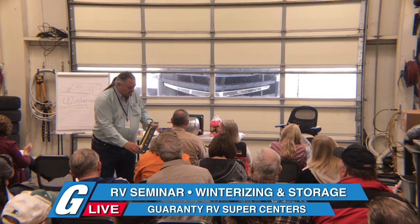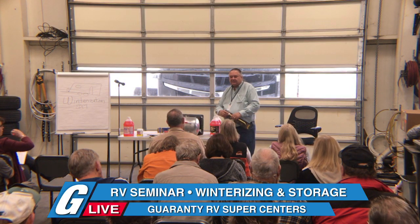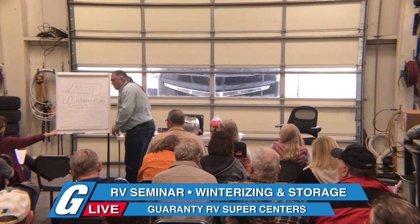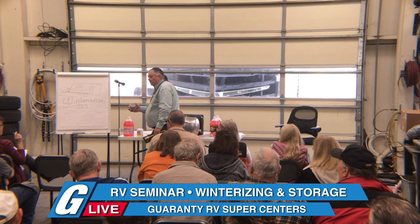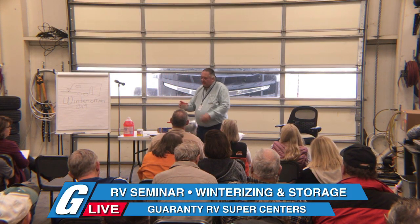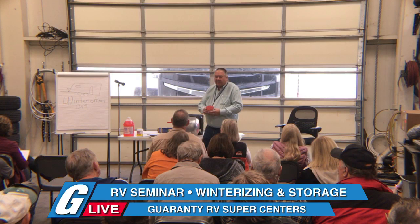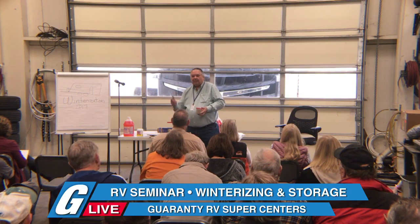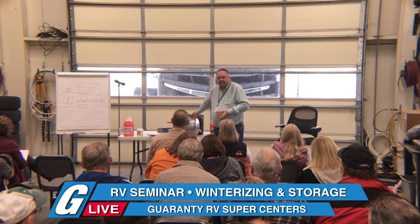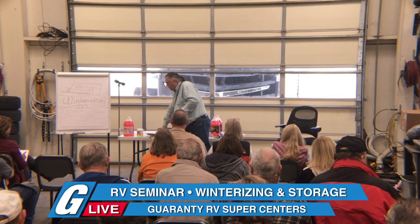It's just a rinser. Same tank saver, tank rinser, whatever. Just stick it in there and rinse it around for a few minutes until none of the crap comes out. And then your water heater is clean. The water heater is the catch-all. Anything that came in through city water, through your potable water, is going to end up in the bottom of the water heater. So once a year in the fall, when you winterize, it's a really good idea to rinse it out. Use this thing.